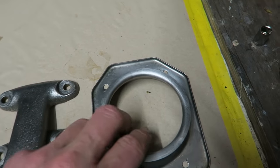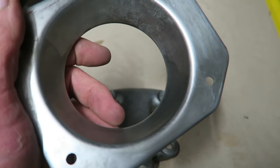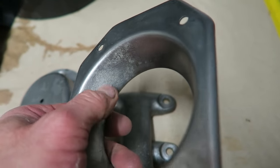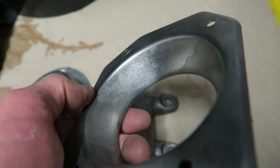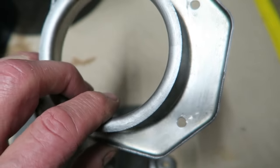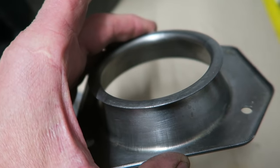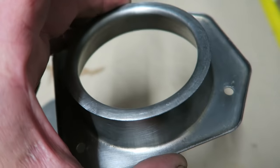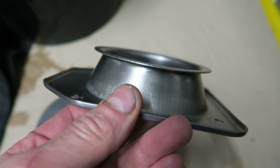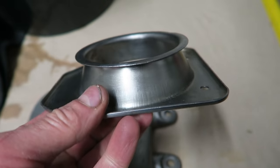I've done a bit of internet surfing and yeah, I believe this was zinc. The passivation is a process that's done to zinc plating afterwards to give it different colours, and this was that kind of greeny yellowy colour, so I'm pretty sure that that was zinc passivate or zinc passivation. Probably pronounced that completely wrong. I'm 99% sure that that's what was on there. And looking at the internet, citric acid dissolves zinc plating in minutes rather than hours. This is what it says. So yeah, that's what it must have been on there.